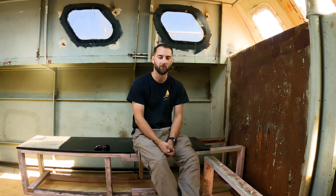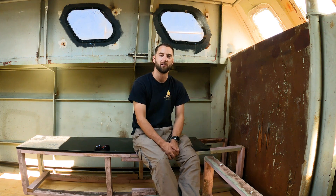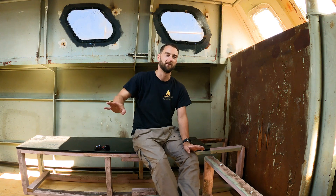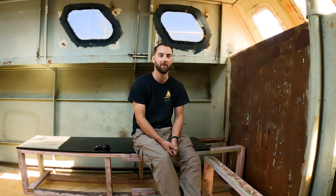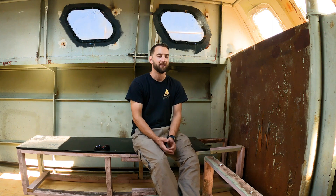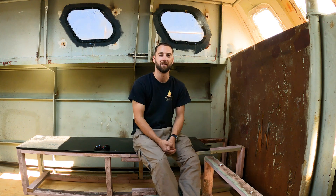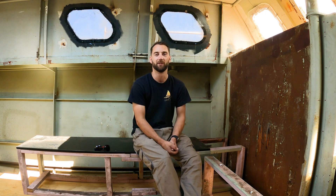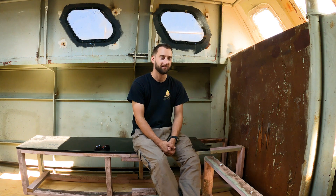We're going to start on lowering the floor, and we can always raise it back up if we're unhappy with the result. The floor beams put in here were never painted, so they're fully corroded — really bad — and only half the welding has been completed. It might just be better to rip this old floor out and start again with new steel, get it painted straight away, and weld it properly. Lowering the floor isn't a big deal because the flooring isn't very good anyway.